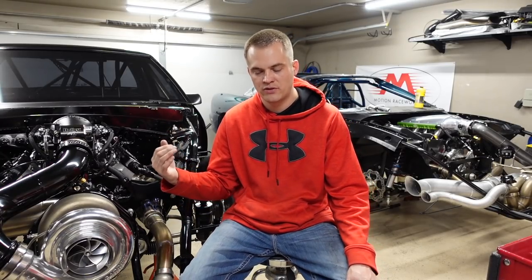I can keep it really tight but give it a little bit of travel to get it going. On the rear extension I actually run pretty tight — I don't have a ton of it, maybe against what a lot of people say, but it works out. I'm light on the nose, I go fast to the 60-foot, and it just works. I'm actually going to try some no-prep stuff in this car this year — the car is so heavy on the rear I feel like it could be set up pretty good for it.